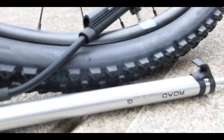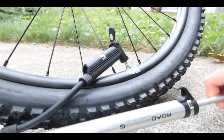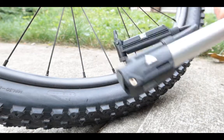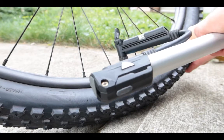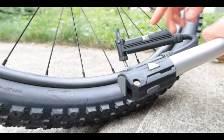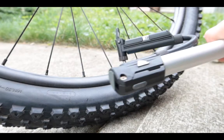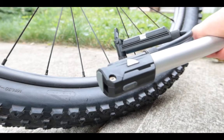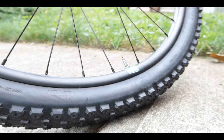All right, let's go ahead and set this up. Now we're pumping it. You want to make sure you feel the tire when you're pumping — make sure you're not overdoing it. It's hard to see on the gauge how much PSI you're pumping in. If you have a good gauge you can see the PSI right on it. Now it feels almost solid because it's getting very tight when I'm doing this. When you're done, move the pump handle down and remove it.